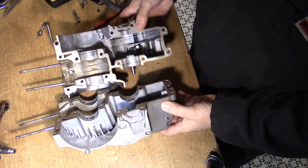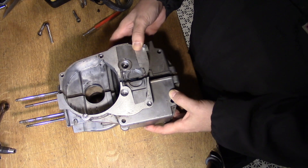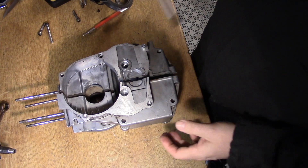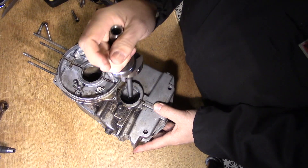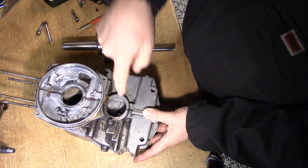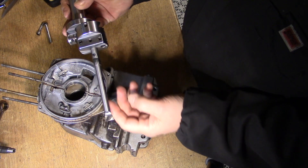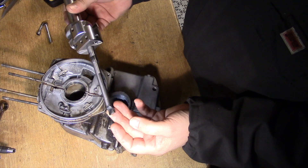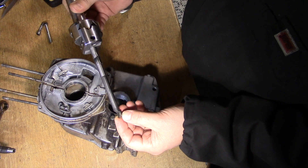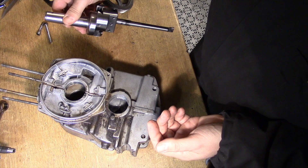The way I want to do this is to carefully screw it together, put it up in the mill, and then use a boring head to reach in from this position and carefully bore it out to the same dimension. The tricky thing is this is very far down, so I had to make a very long boring bar and take quite small cuts. Otherwise it won't be good — but I think it will work. We'll see. Otherwise I'd have to scrap the engine, and I hope not.